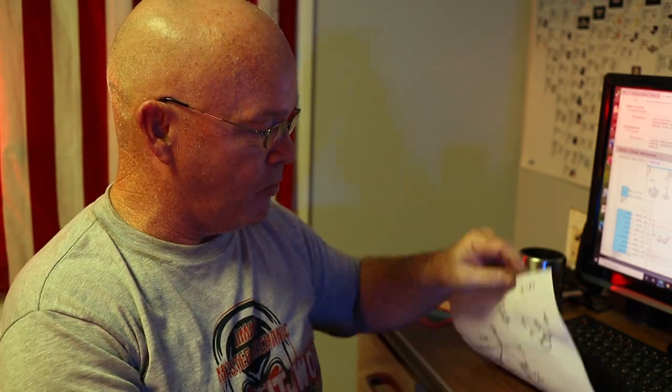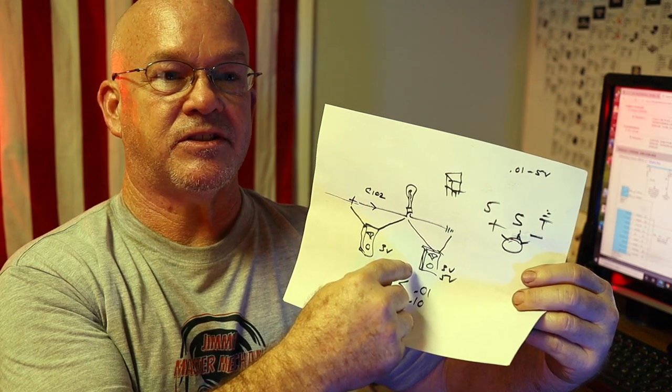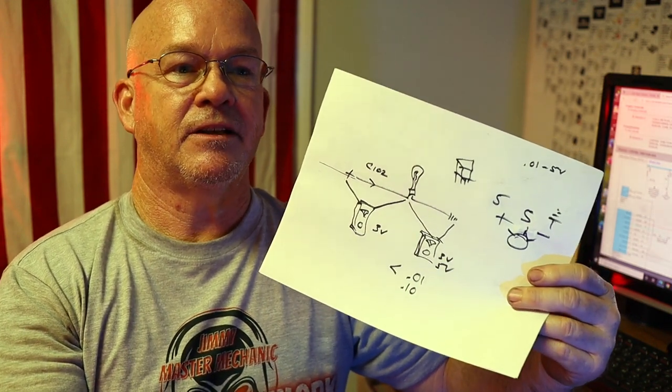When you're checking a light bulb, most of the time if you have a dim light bulb it's not going to be a bad bulb — it's going to be low supply voltage or poor ground due to high resistance. High resistance means the current can't get there; low resistance means it gets there really good. Sometimes a short is actually low resistance, but 'short' generally identifies that power is going to ground when it's not supposed to. A short means you've got a connection — even if you don't want one.